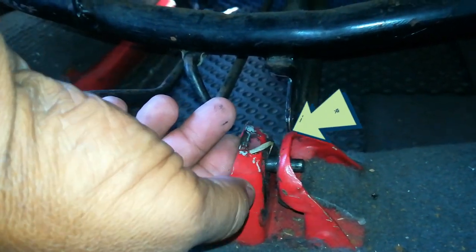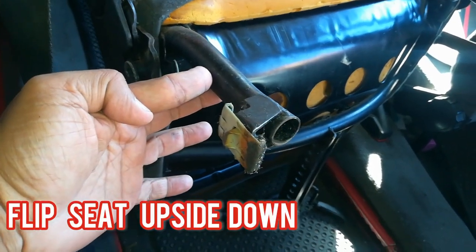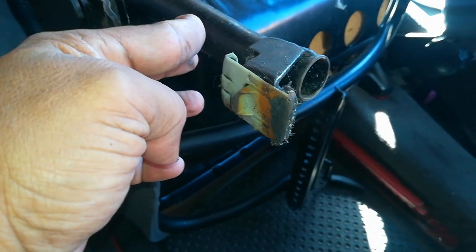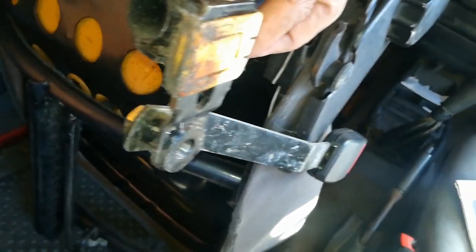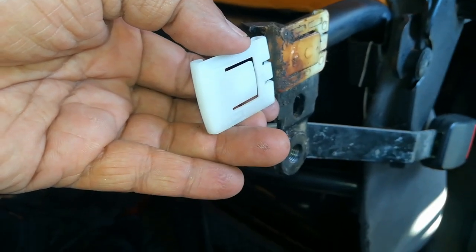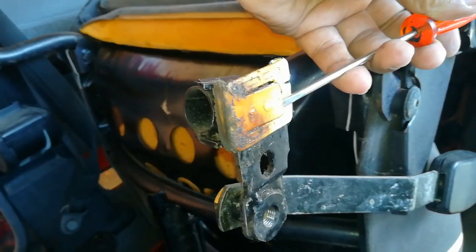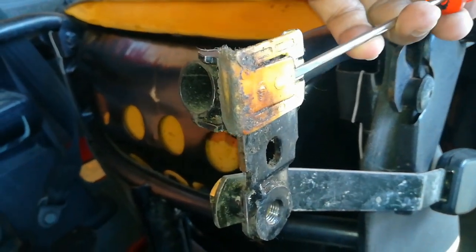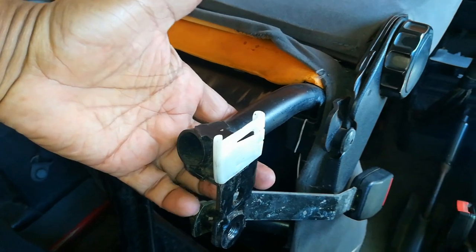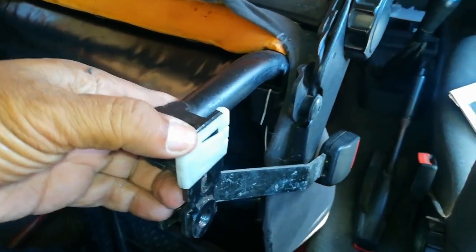You can see there is no rubber - it's non-existent, as I said. I've pulled the seat right to the back and flipped it upside down. You can actually see the existing plastic components - they're quite old. There's the new one. Make sure you put the same one back on the correct side because it has an inner and an outer. To get them off, just use a little screwdriver, poke it in here, pull off the old one, then simply fit the new ones. They're a bit tighter because they're brand new, so just use a bit of force and push them down. There you can see it's perfect.